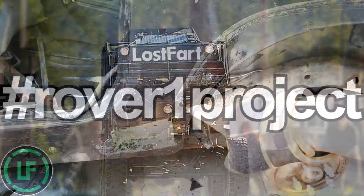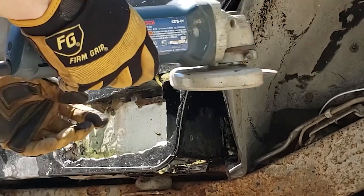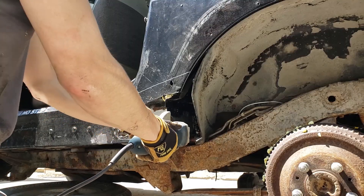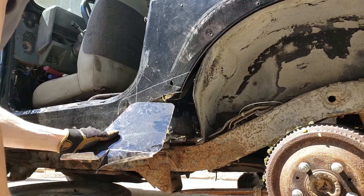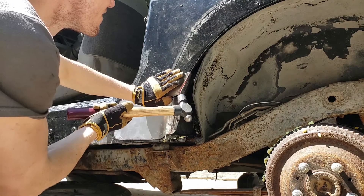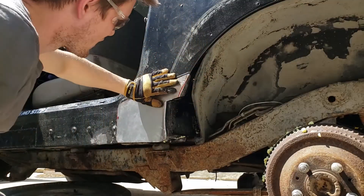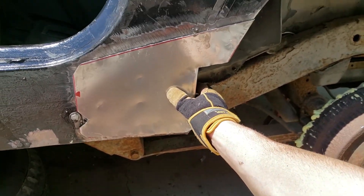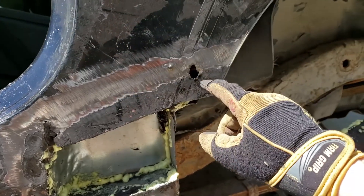Let's just react to this for a minute. Let's cut this out a little bit. I marked on here where I've got a snip with the tin snips. Now I've got to bend this back with a hammer. Pretty much just like that. A few more tweaks — something like that. And it fits pretty good. These holes I have to take care of from inside the vehicle, which is why I have to remove that speaker box.